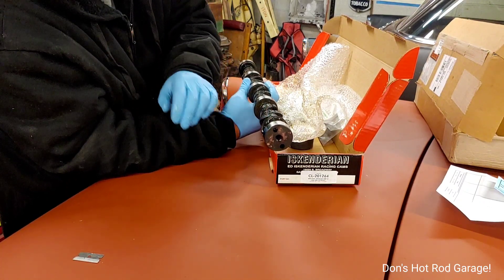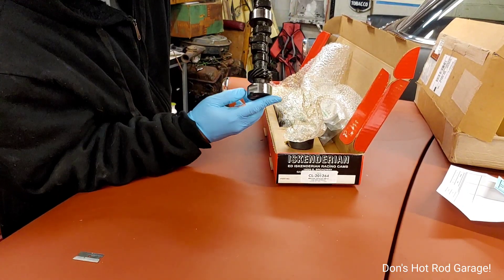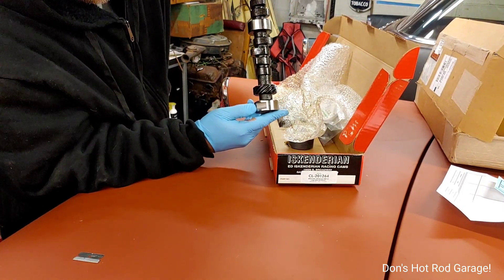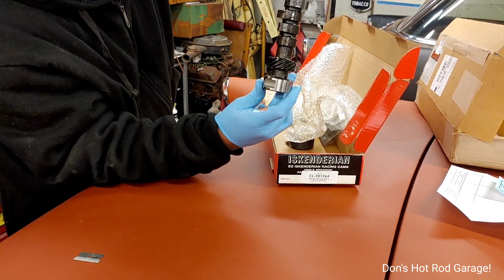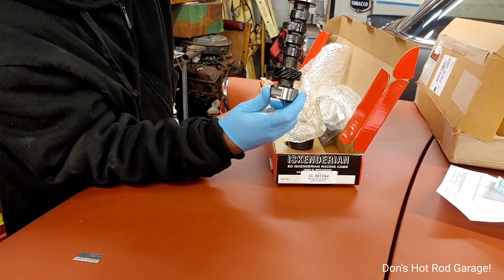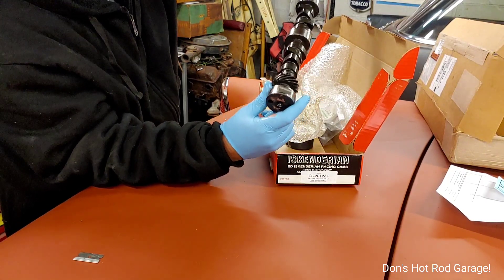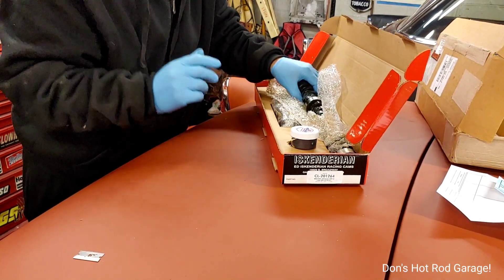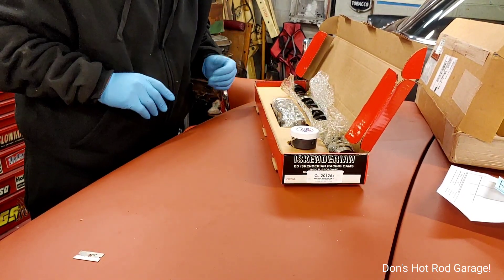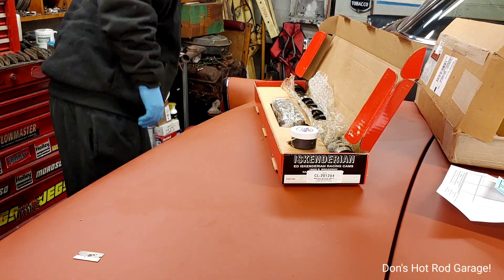It's got real nice ramps on the camshaft. See this — this is what they machined into the back of it, and all that does is give you a pulsated oil flow to your lifters. The '55 Chevys are totally weird and unique like that.